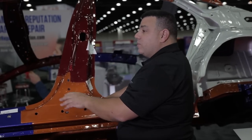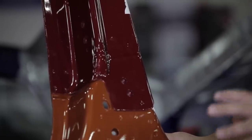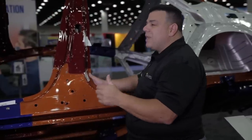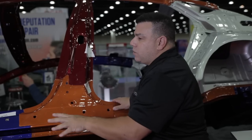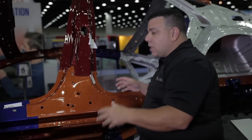If you heat these higher strength steel areas and try to pull, it starts ripping apart from the inside. If you butcher it back together and the car encounters bad roads — potholes like we see in New York and New Jersey — the car starts ripping itself apart. Incorrect repairs don't last anymore. Guys who try to pull vehicles incorrectly often wind up with a pool in the trunk because seals aren't exact. Welding tabs to pull is usually okay with copper pins or dent removal systems — it's a much lower temperature and not a full fusion weld.